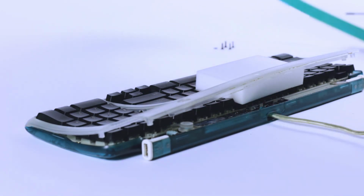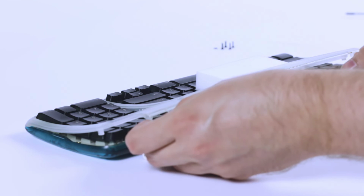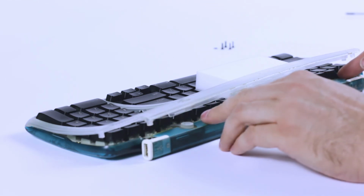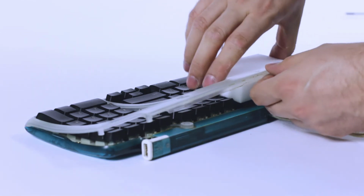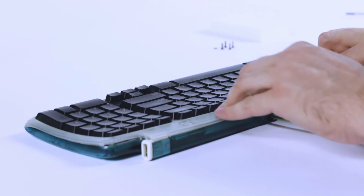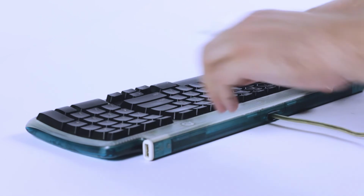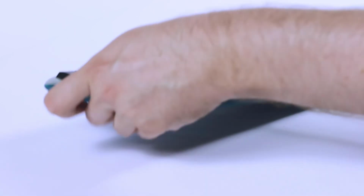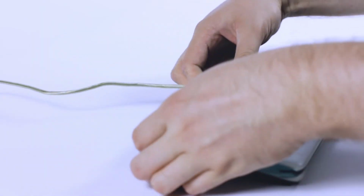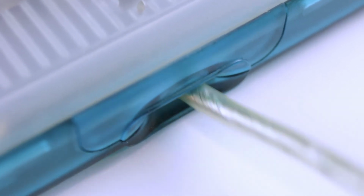And then all you need is your plastic strip. Just lays down over top of this whole mechanism here, and it roughly centers around the power button. And now you can clip your plastic back on. Just go all the way along the back and the sides and the channel to make sure that it's flush and nothing's sticking up. And you're reassembled. Time to put the screws in and try it. That cord is affixed just as though it came from the factory, and barring a severe tugging, should never come out again.